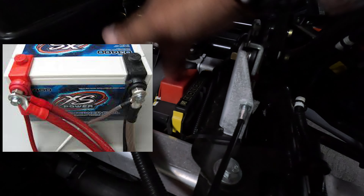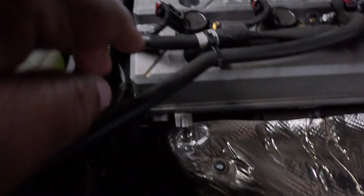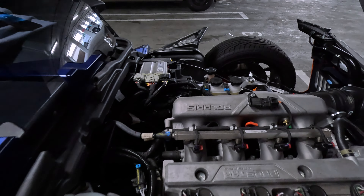You want to take your ground and your power both from the battery. I routed it inside wire loom, up along here, and over to the block. It comes down in the wire loom and bam — it's all connected.